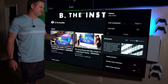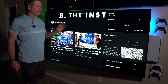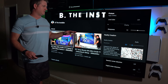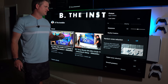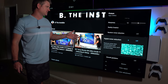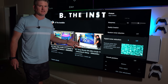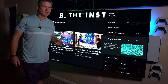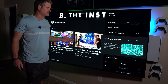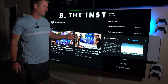In clarity, sharpness is left at 50. Reality creation and noise reduction are left off in SDR. In SDR you're going to get a lot of poor content, so messing with some of these things can make it worse. There's random noise reduction — kind of like spotty images in darker areas — and digital noise reduction, which handles compression noise like block noise around letters. Sony pretty much explains all the different settings so you can tweak them as needed. If you're watching SDR content like older movies, they normally look pretty poor on OLEDs, so I typically raise both of these up to medium.